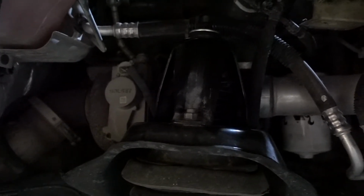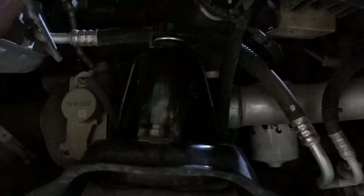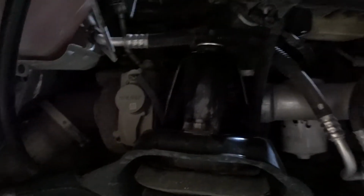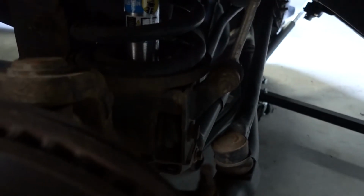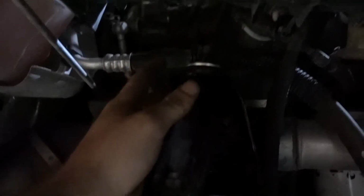And as you could tell, the special guest, my wife Carrie, came out. I muscled it down, and she got one shock tower mount nut started. Once you do that, the trick is to suck that nut down as much as you can while keeping the other 2 studs in line with their holes. Then you can push it over to each hole, grab some threads with those nuts, and start sucking those down. After that you can finish torquing that bottom bolt down and torque that top nut down. And really all you want to do is see just a little bit of squish in your insulators.